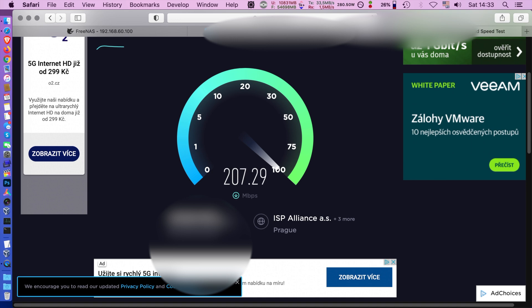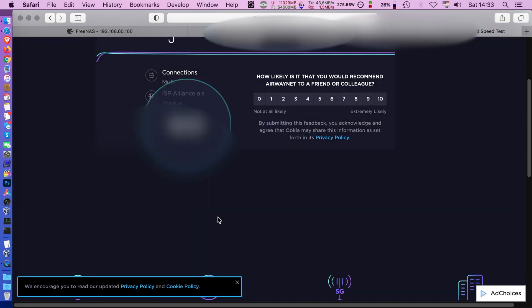If I run another test you can see I go above 200 megabits — though it's just a burst. With the traffic shaper you get great upload performance, people can do video conferences, send files to online services, and DNS lookups don't get slow. I'm really happy with this setup and I recommend it to everyone, because if someone's uploading something without a proper traffic shaper, DNS lookups get very slow and you can't browse the internet.